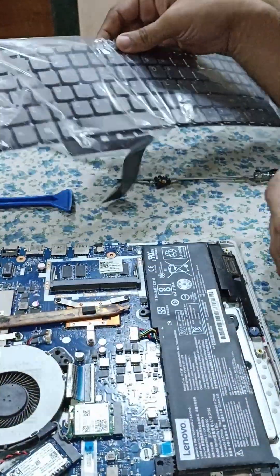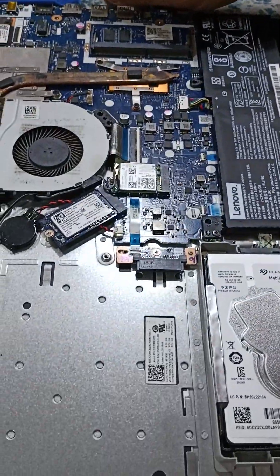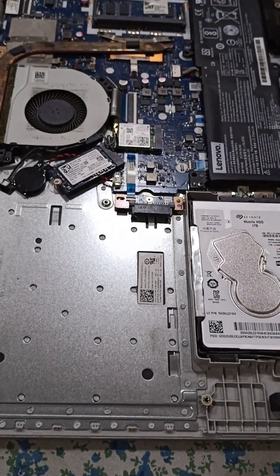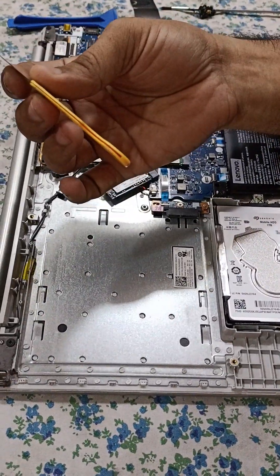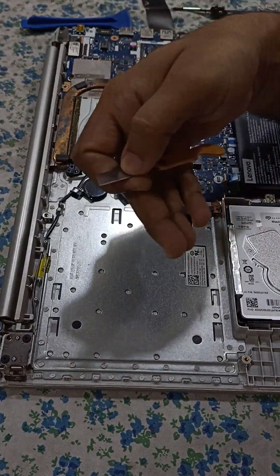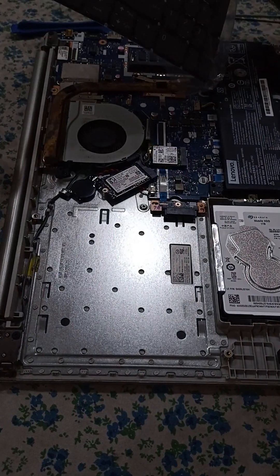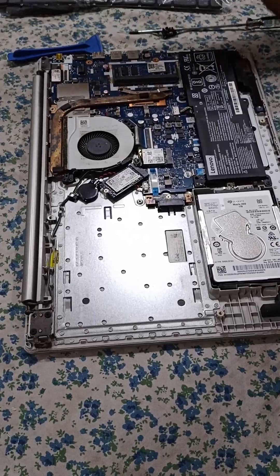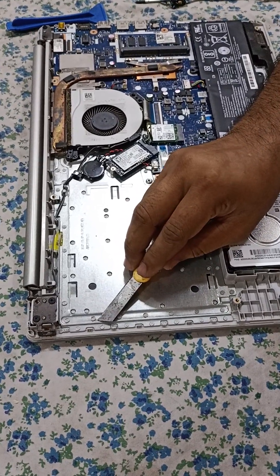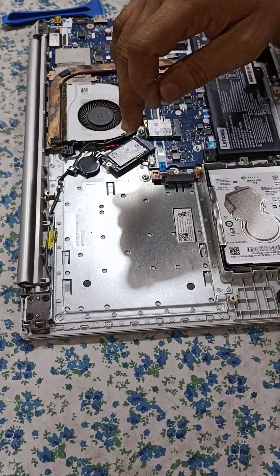The laptop is working, so we have to remove everything. These are the solder points. We can cut with the help of a small cutter — just clear that point and remove this plate from the top side. Then you can remove the bottom keyboard and install the new keyboard. After fixing the keyboard, we have to solder these points again. If the solder is not proper, the keyboard position will not be fixed correctly and the keys will go down while you are pushing them.